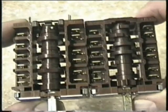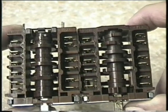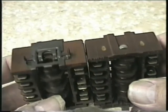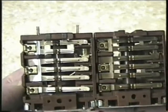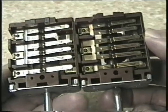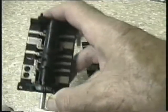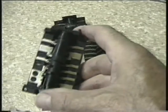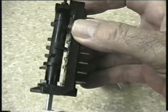On first glance these two look the same, but if you look closely you will see the cams are slightly different and one has a harness on the end. Also when you turn them over you can see one of the contacts doesn't go right across. Both switches are for the same cooker but the harness is there to support a piggyback thermostat which operates the oven. There are a number of manufacturers of these switches so they do vary in shape and style, although they all work in the same way. I only have two different types here, just to illustrate what I mean.